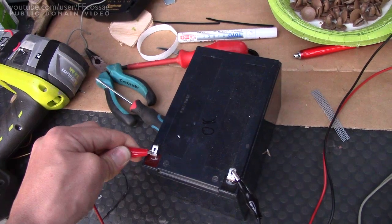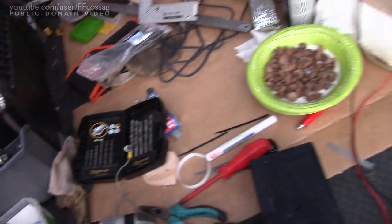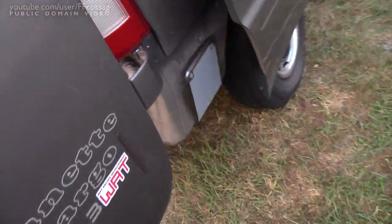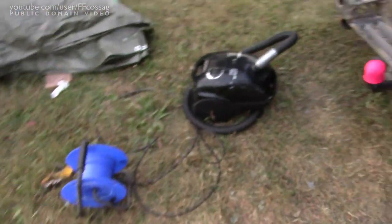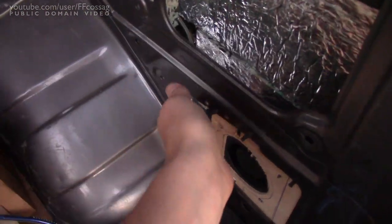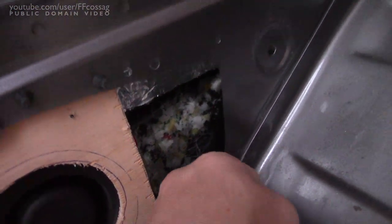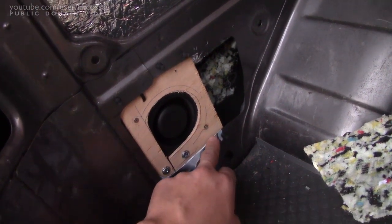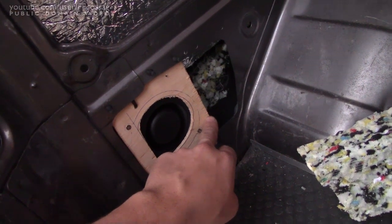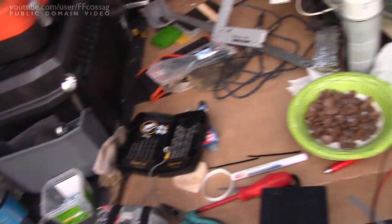We've got everything wired up for a test - let's see if they'll run. Now that sounds very stereophonic. Both fans are indeed running just fine. There's a fair amount of air coming out from the filter - some feedback since I haven't put the insulation in, so a lot of the air is poofing back out. But that's going to be remedied. I'm really happy I made them on rubber grommets, because if I touch the metal of the vehicle it's barely moving, but if I touch the fan mount there's about a 100 Hz vibration that's being entirely absorbed by the rubber mount. Definitely going to need a speed controller though.